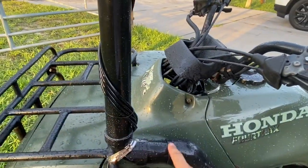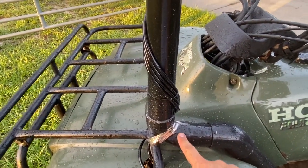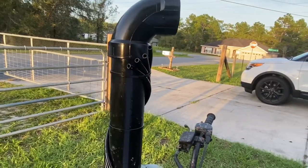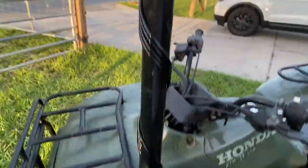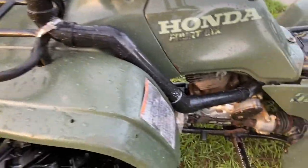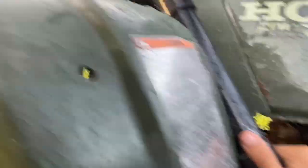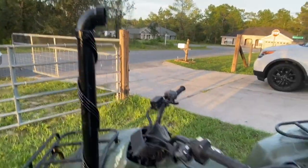Then there's a short straight piece, about five to six inches long, going to a 90-degree fitting. Then a straight piece about 24 to 28 inches long, and then a 90 at the top — I plan on making a fancy tip eventually but left it as-is for now. Make sure all connections are sealed with PVC cement to keep them watertight and prevent movement. I secured one section with a zip tie around the starter, drilled two small holes in the plastics to keep it from moving, and used a hose clamp to keep the connection steady.